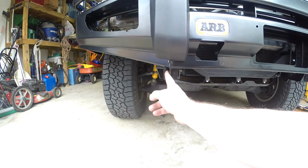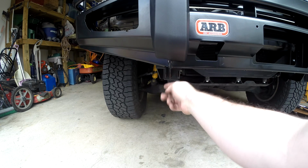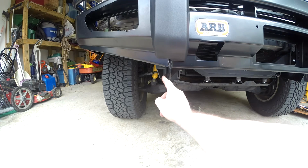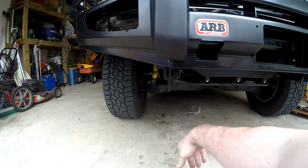So I'm trying to get everything lined up, and I realize this pinning hole is way, way out, and that's not going to come up tight. So I need to loosen this bracket again and hopefully get that lined up. But if you remember, this bracket didn't have a whole lot of wiggle room, so I might need to hone out that hole that was a little off.